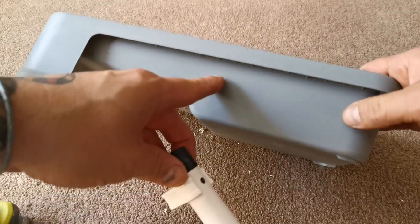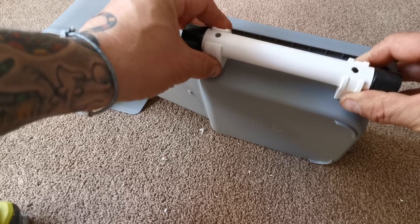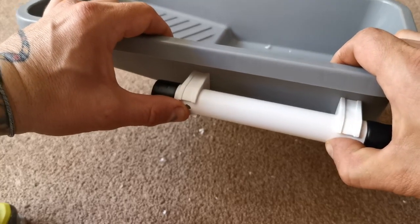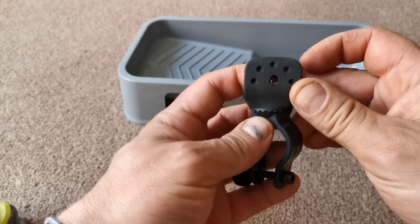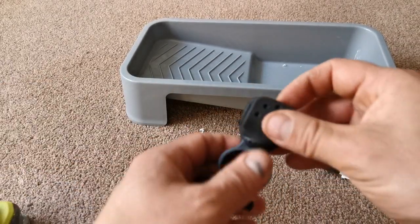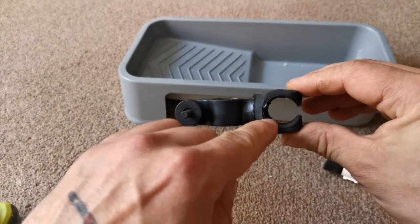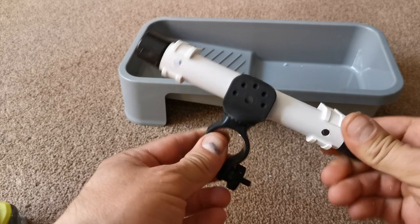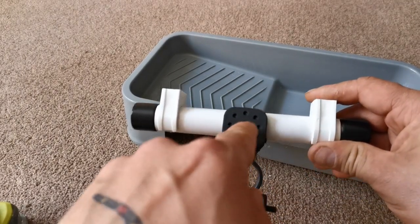This is going to get mounted on the side of the tray — I've already drilled two holes that I've checked match up. I've also drilled a five mil hole through the mount, the same size as the bolt. There's a third hole which will act as a locking bolt through the centre at the top of the arc. Because the inside of the clamp is smooth, it can slide on the pipe under pressure, so this hole will let me lock it at a set angle.